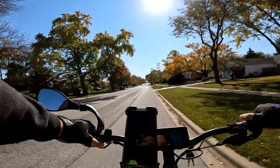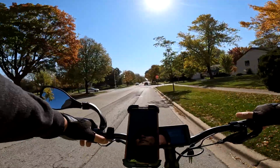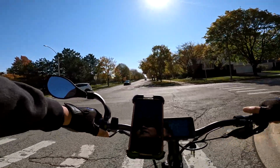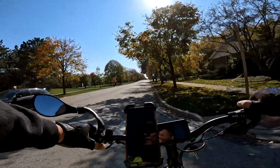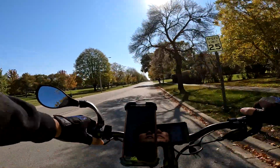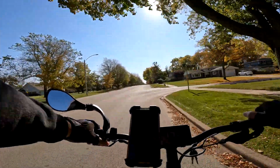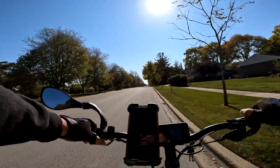So another thing that we noticed with some of these fires, besides the charging issues, is that sometimes the batteries are charged and set up on their bikes in parallel. And as you know, when I do a double battery system, I don't run my batteries in parallel. I don't run them both at the same time. I run one, and then when that one exhausts, I unplug it, and then I plug in the other one. Okay, I think personally that's safer. It might not be as efficient.